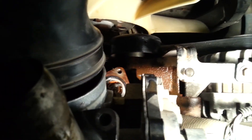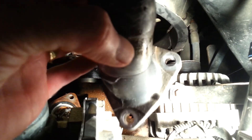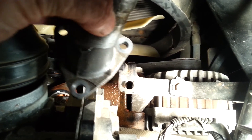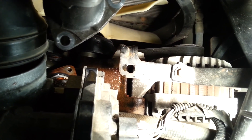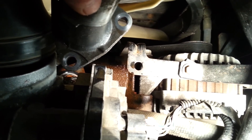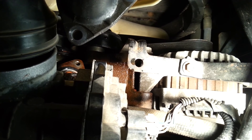I'm going to pop the hose off and get that out of my way to see what those bolts are like. Hopefully they'll ease out without giving me much trouble. The thermostat adapter came off pretty good — it takes a 13mm socket with an extension. It looks like it would be hard to get to, but it came out pretty well. You can't get exactly straight onto them, but I used a 6-point socket and put good pressure on it and it came right off.